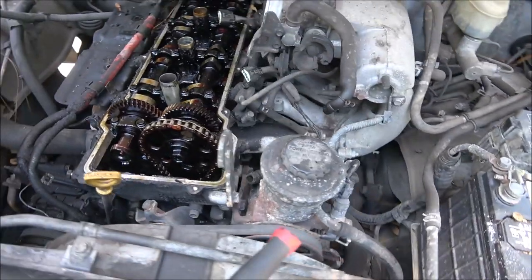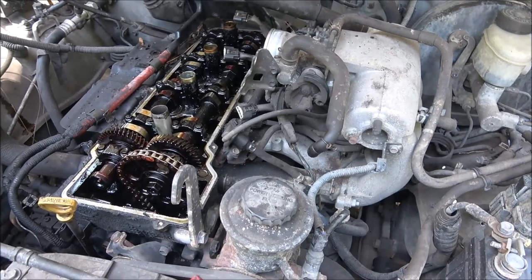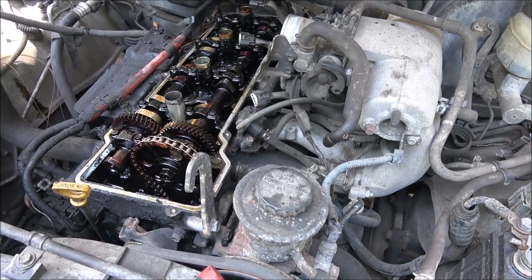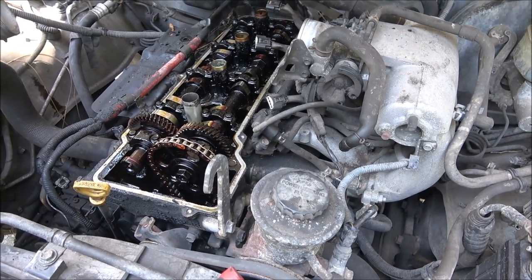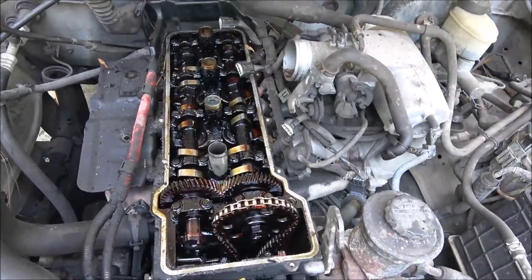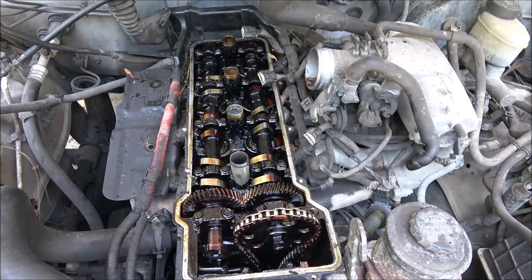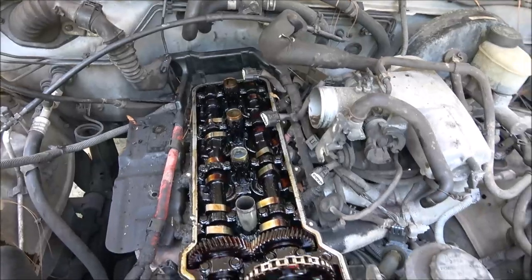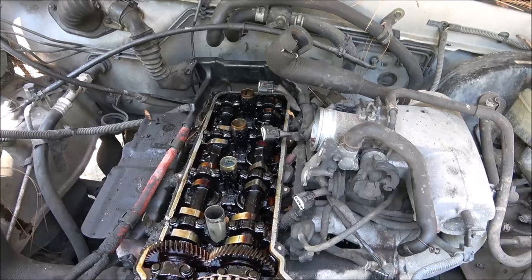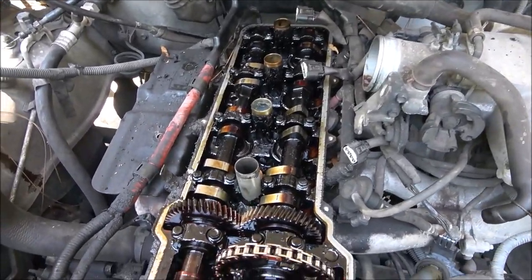Yeah, I mean, like I said, it ran down the road 75, 80 miles an hour, right along with the best of them, not miss a lick. But you come up to a stoplight, and you're sitting there, you can kind of feel it running a little rough. She couldn't tell it, but I could. But as soon as you stomp down on the accelerator to take off from that light, that's when it would do this, that hesitation. Until you get about, well, when it shifts into second, third gear, it was okay. So it was only when you stomp down from a dead stop.